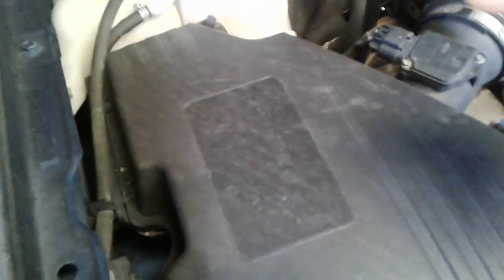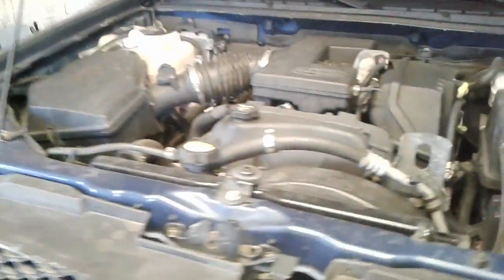I'm going to take everything apart — the mass airflow — and there is a ground wire right here where my finger's pointing. That goes to your blower motor. Most of the time it is on the passenger side. I got everything working because I jiggled the ground wire and it started working. If you're switching settings and the blower motor's not turning on, you most likely have a ground problem.